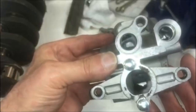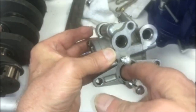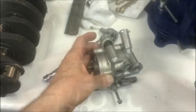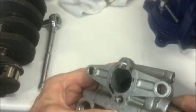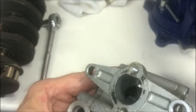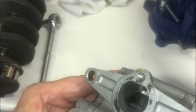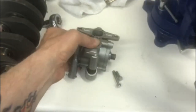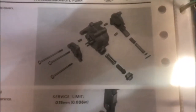If you look inside there, there's all kinds of sediment and sludge in there - and that's not good to say the least. The way that the oil pump functions is that it rotates; they've got little propellers in there that rotate and pump the oil through the oil lines and circulate through the engine. When you have all that sediment in there, this pump really does not turn smoothly.